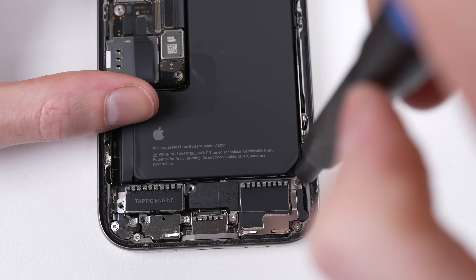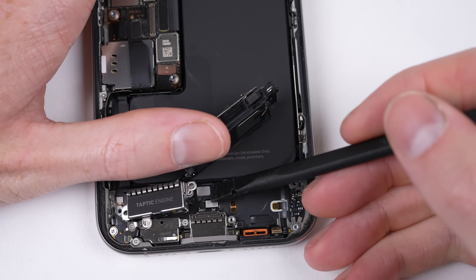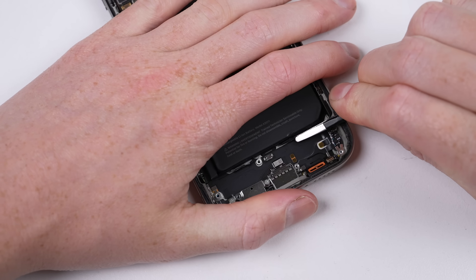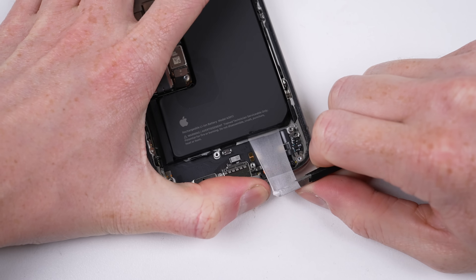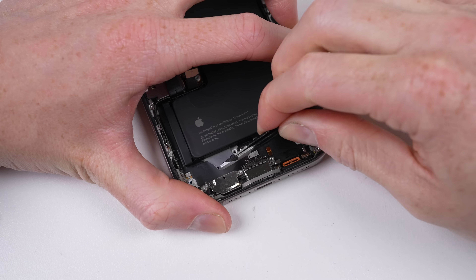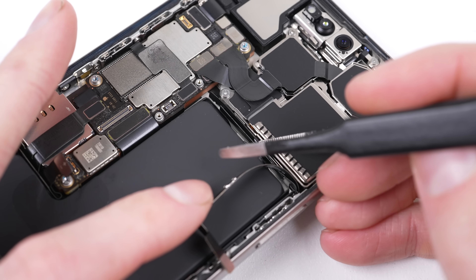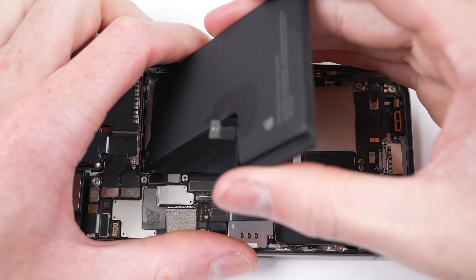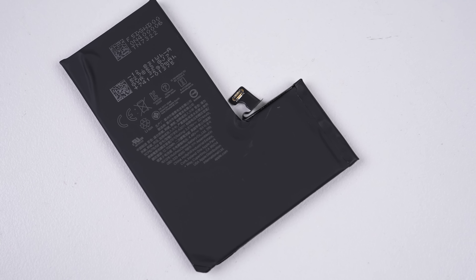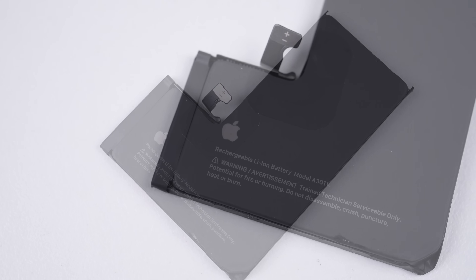It's not all bad news — there are some good things to come out of the iPhone 15 Pro in the way of physical repairability. I'm going to continue the disassembly on one of our iPhone 15s from here on out. I'd like to get a look at that new USB-C charge port, but before I can, I need to get the battery out. I almost lost one of those release tabs, but it pulled through. There is one more at the top, however it's quite hard to access, so I can just lift the battery out from the base.